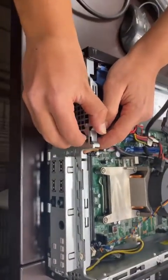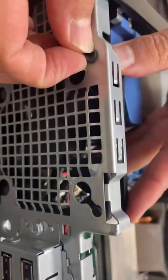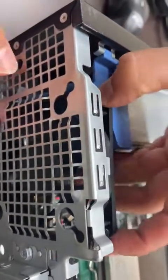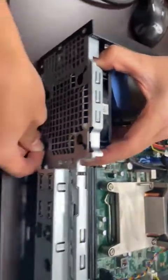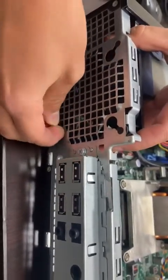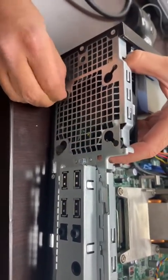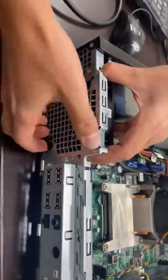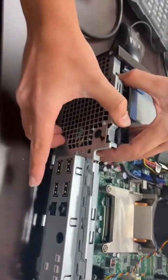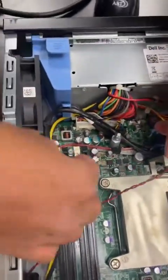We remove the face so we can access the screws of the fan. Start with the easiest rubber mount — twist it a little so it actually comes out. Then do the others. I always like to start from the top. Don't be afraid to twist them — grab them with your fingers and push with your nails and they should come out fine.